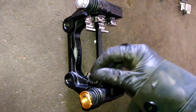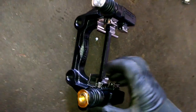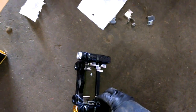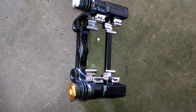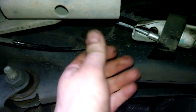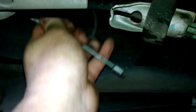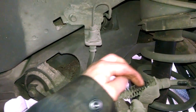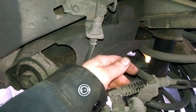Clean them up nice — that should be fine. To get the pad on the driver's side, put this through that hole to get yourself the slack to work on this side. You should be able to pull this cable through and give yourself the slack to lift it off of this little arm here.